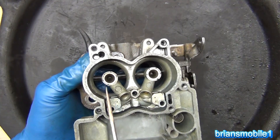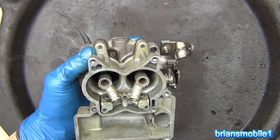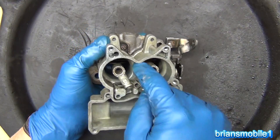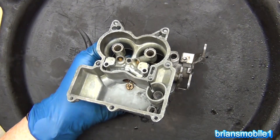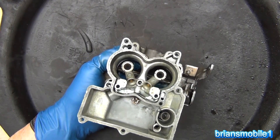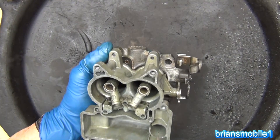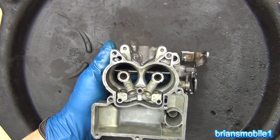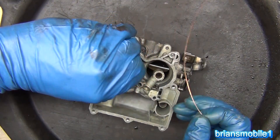You've got two barrels and two jets here — all the jet business is right here. This is like that straw I was blowing on. As air blows across, the very tip of the straw — the main jet — is right here on each barrel. Fuel goes in through here and gets squirted in from here. You've got all these different holes and things that can get plugged up, which is what we service. This one I've already serviced and cleaned — let me show you where it had blockages.